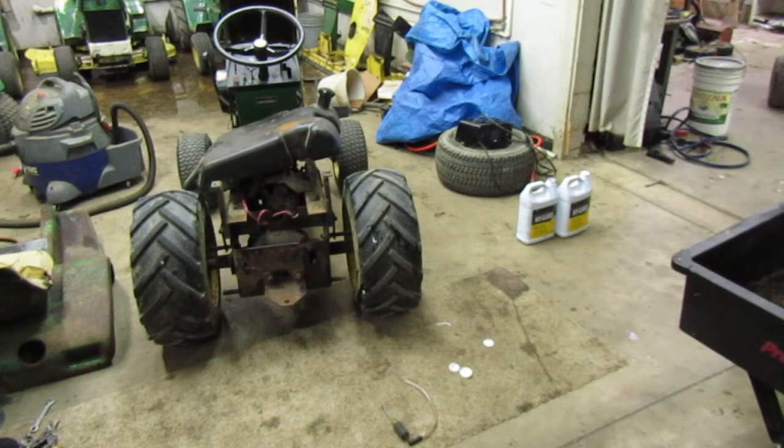So guys, this is future me. I decided to take the top back off of it and I put a little bit more fluid in the transmission. I ended up using that full gallon. I fixed my sight tube, I just made a different one and stuck it on there, with a little peephole instead of having the tube that likes to kink up and not bend. So I put that on there and I used a gallon, and in the second gallon, I used barely even a quart of that, and it was full. So, not full to the top of the dipstick, but it was full to the point where it should be on the sight tube. So, that's where I'm going to leave it.